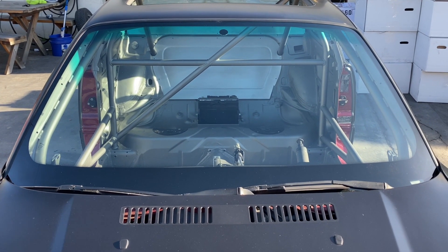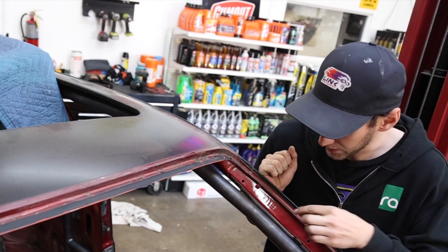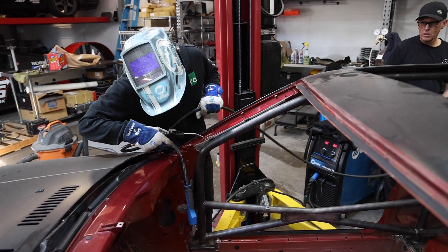Otis said it's pretty much good — we're just going to hit it with some primer. We'll re-glue a new windshield in here as soon as we get done painting it. Now I figure I need to scotch-brite all this, scuff it up real nice, and then I'm going to grab that welder and go ahead and lay these beads right in here. That will be the last weld on the chassis for the cage.